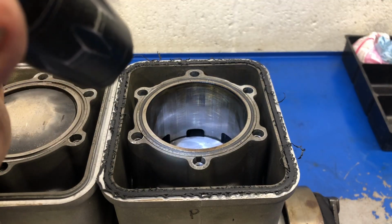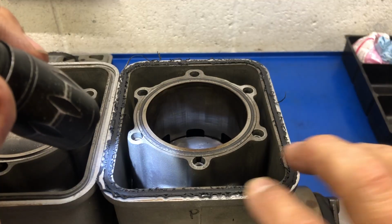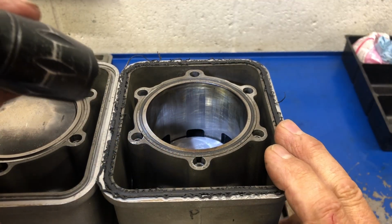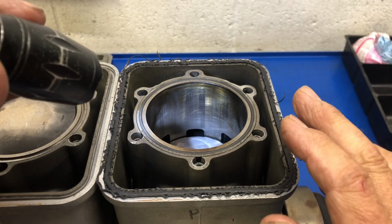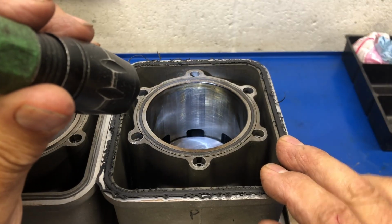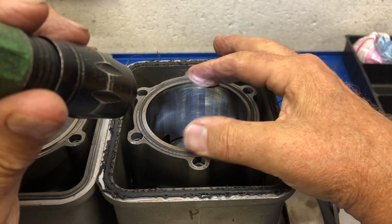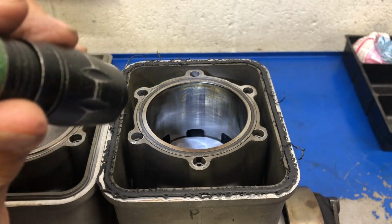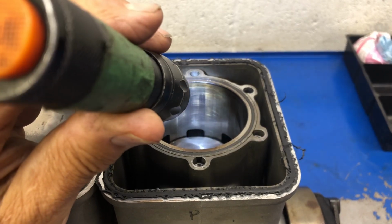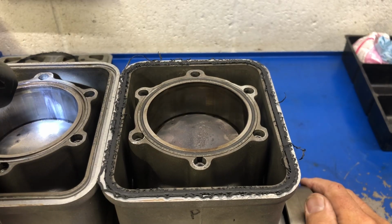It's because, and I already know, of course, when I see this rubber ring in this condition, the engine has been heat cycled, super hot, cooled, whatever. When I see this, to me that means that the piston expanded so much and much faster than the cylinder expanded that it lost its clearance and was right next to transferring aluminum like it did in the other cylinder, like right there.